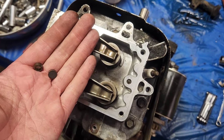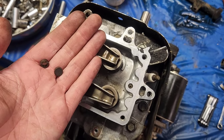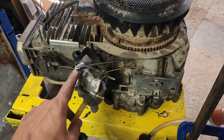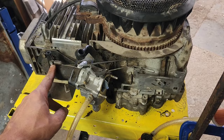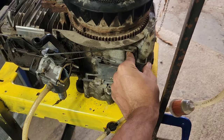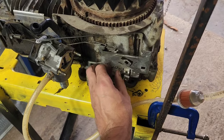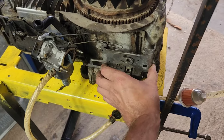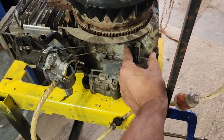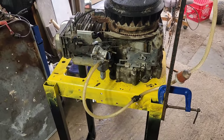I set them aside so I wouldn't lose them, but then I forgot to install them — tuning in valves, round two. Before I cover it all up, I wanted to show the modification here: we've got a spring going from here to here, so this is now throttle and this is now independent choke. You can use the choke that's already on the chassis, and you can use your throttle cable right here. All set, ready to go.